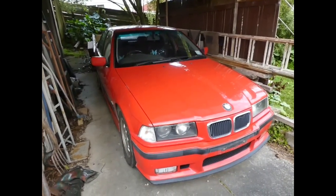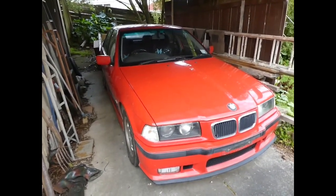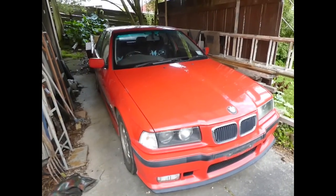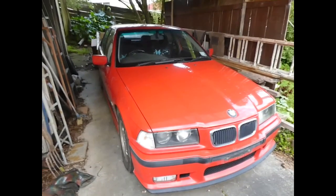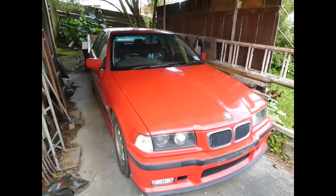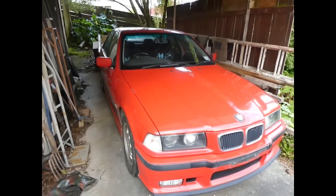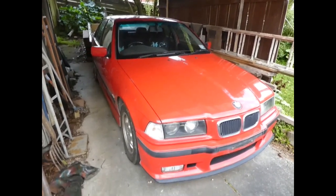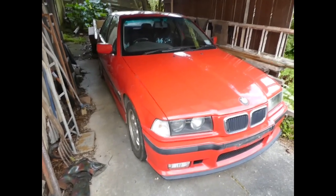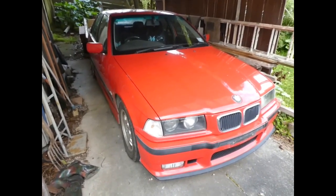This is my 1998 BMW 318 IS, 4-cylinder, twin cam, 5-speed. It's done 240,000K. When I got it about 5 years ago, the clutch slipped under absolute full power. Now it's slipping under about 90% power, so it's about time I changed the clutch.